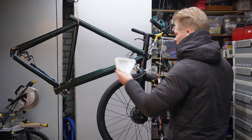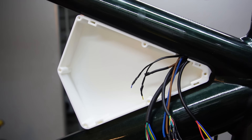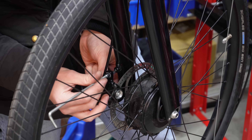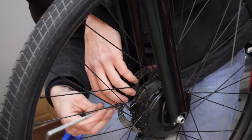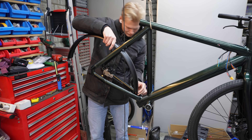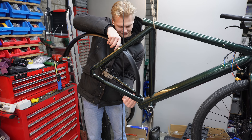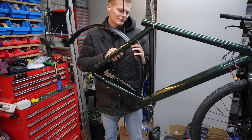So this is what I came up with: a little 3D printed box that houses the controller and all of the cables. I painted it black to match the stealth of the bike. While that was curing, I moved on with the brakes. Luckily these are mechanical disc brakes, which means they operate with a normal cable instead of any hydraulic fluid. When adjusted properly they have pretty decent stopping power without all of the mess hydraulic brakes bring with them. Next up was mounting a lot of stuff back up to the bike, and after that was done it was time to finish the little controller box.